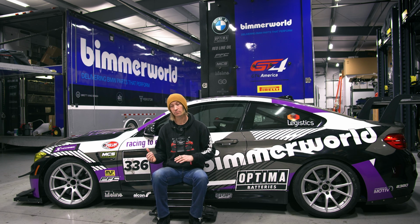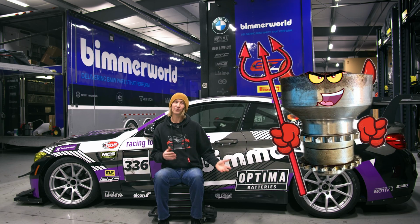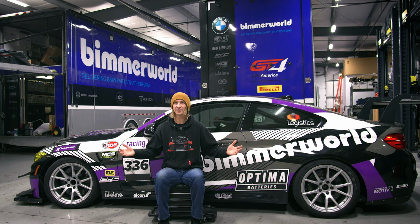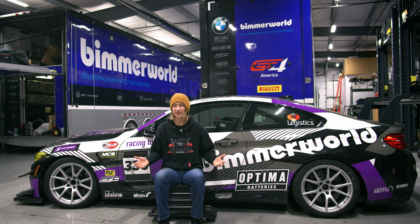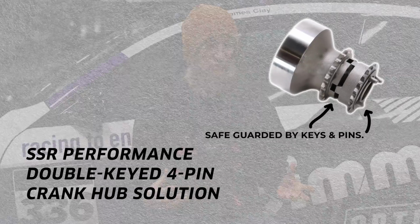We also hit the nemesis of the S55 engine, the crank hub. A lot of people think you don't need to do it. A lot of people think it's a must, you have to do it. There's varying opinions all in between. When you get to this power level, I'm gonna do it. And we went with the SSR 4-pin crank hub solution.